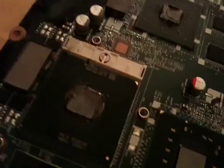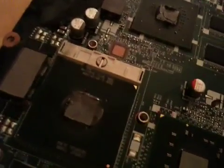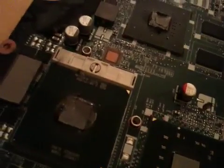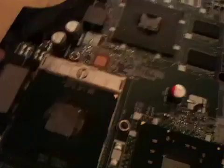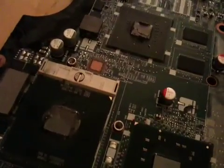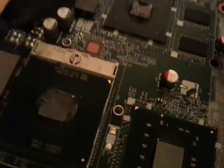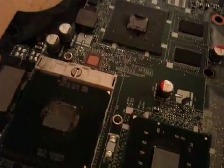So I'm going to be removing the paste completely and reapplying it. This is actually evidence — and I'll be submitting some photos — that Arctic Silver 5 handles the job really well. This laptop had this thermal paste applied about six months ago, and the point when the ceramic paste dried out was actually at six months. As you can see, there is no drying out of this paste, which proves my point that Arctic Silver 5 is really well designed.